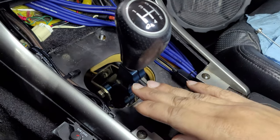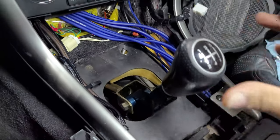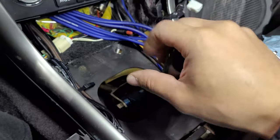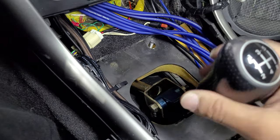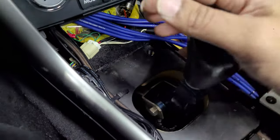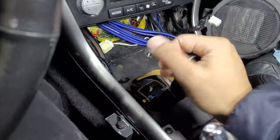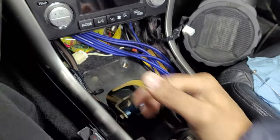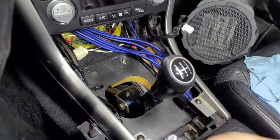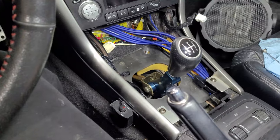What I was finding is that when I had this sit as low as possible, I was having difficulty getting into second gear — it would hold there for a second and then it would pop itself back out without me touching the clutch or anything. And when I had it too high, I was having some issues too. So what I did is I loosened the bottom bolt — not this one, this is the second one, there's a third one down there — loosened the bottom bolt, played with the height of the shifter a little bit, then I took my knob, screwed it on there, and just went through the gears like I would as I'm driving. So it seems to be working really nicely. If you're going to have issues, it's most likely going to be second gear or fourth gear, so just play with the height there a little bit.